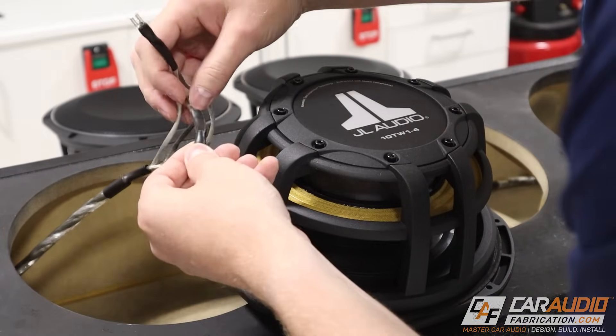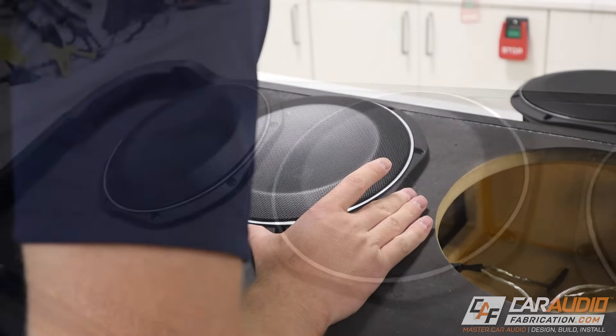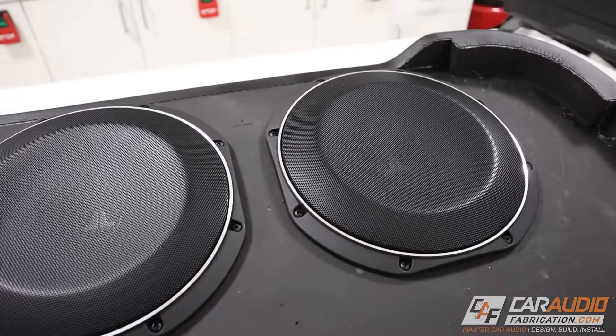So what is the wiring style that we generally want to try to avoid? When designing our car audio system, we want to try to avoid series wiring between subwoofers. Each and every subwoofer and speaker in existence is going to have slight differences. Even if they are the exact same model — which they should be, because you shouldn't be mixing models — it's unavoidable that there are some small differences in manufacturing. Additionally, with multiple subwoofers, it is quite possible that even their positioning in the enclosure will lead to slight differences in their loading and mechanical behavior. In series wiring, these small differences can result in induced voltage or back EMF across the series connection. Essentially, the subwoofers can modulate one another and cause distortion.